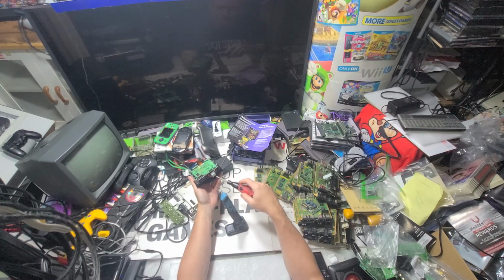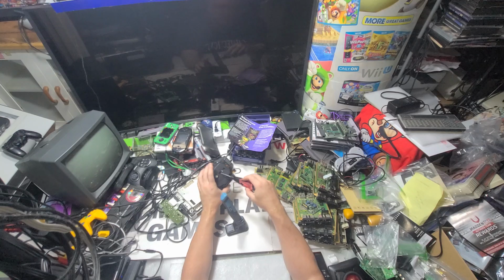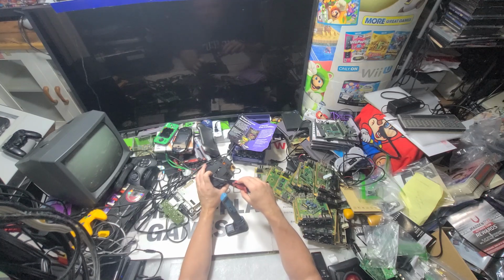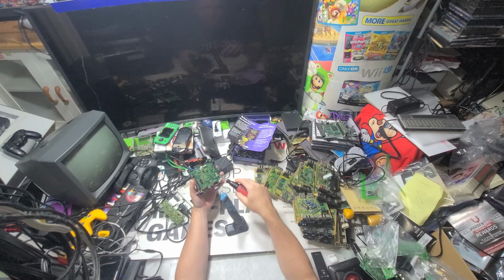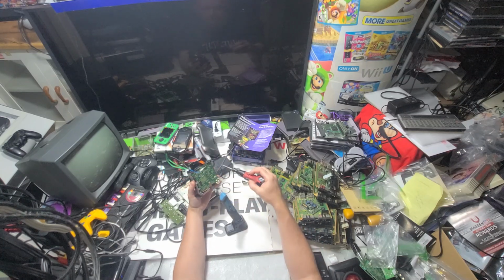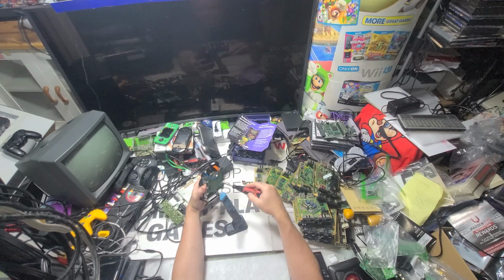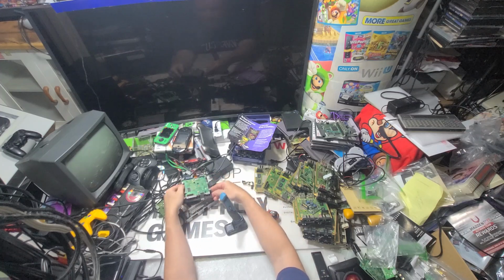Be careful when you take this off, because if you get a clip on either end of these, then this will do what I call the spindle jiggle. It just sits there and jiggles, never spins. It's because one of your sides is probably broken, so it's not getting the full signal. Just a little heads up there.